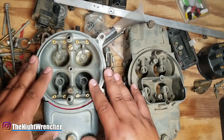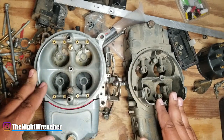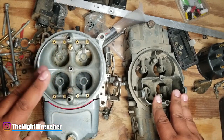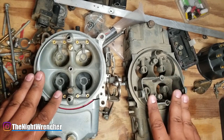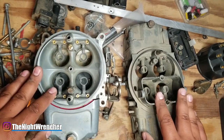The calibration for your carburetor is now so far off, you're going to have to retune it for your current application. There are two basic ways to get your tuning done: the first one is a street tune and the second one is a race tune. I don't think a lot of people call it that, but I'm just going to use that designation for now.